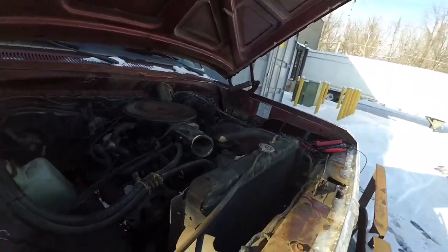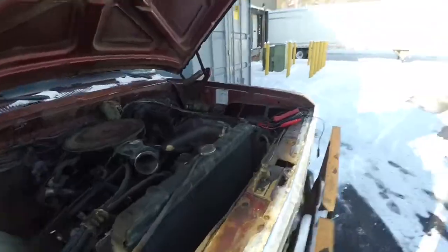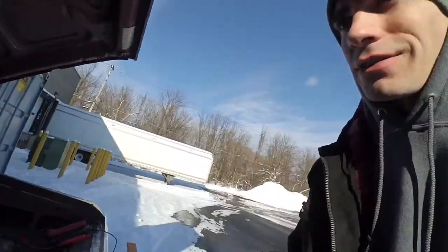12.6 to 12.7 around there after it's been sitting for a night recharging — so it's really not terrible. However, there are further things you can test on a battery. Just because it has a 12.6 volt reading doesn't mean it can necessarily put out the load. I know there are other things that can go wrong with a battery even if it reads a good voltage — it might not have the power behind it to start a car or truck.